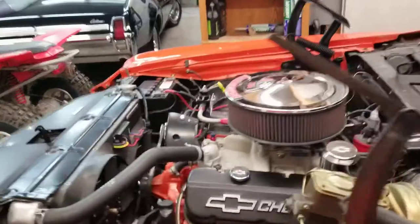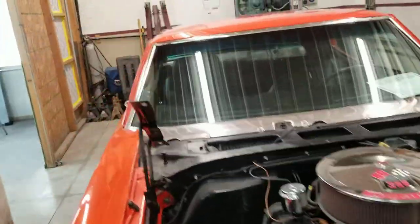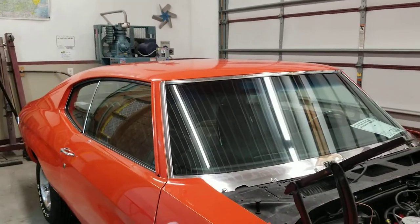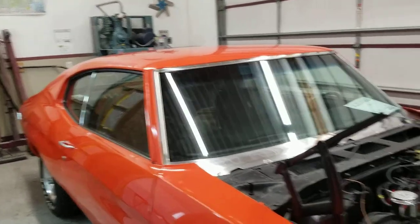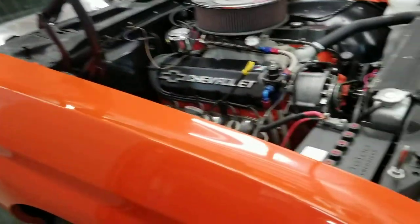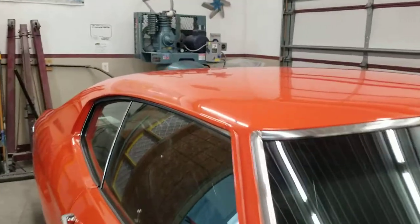Get the hood on it. I'm going to do a little work in the trunk, clean that up a little bit. Got some pinholes to fill and spray a coat of epoxy primer. Then when Bill gets it back, he can spatter paint it. I think the color is going to match pretty close. I'm keeping my fingers crossed.